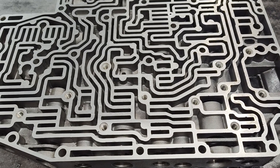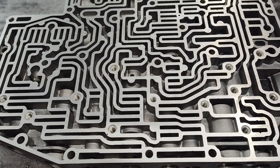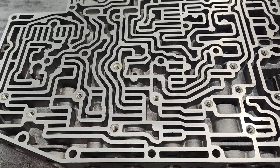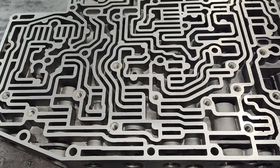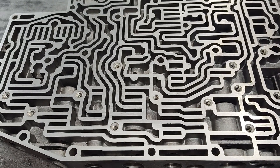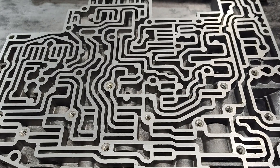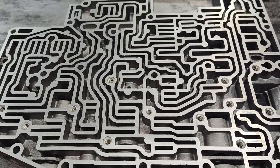This unit is typically pretty burnt up because pressure is so low in them. What happens is when they shift into third gear, the pressure drops — it's what they call the cutback circuit. So your pressure goes from, let's say on a high throttle run, you leave in first gear and you're making a good 200 pounds of pressure. Well, when it makes a 2-3 shift, that pressure will drop to like 100 pounds. And especially if your TV is not properly set, you may only make 75 pounds or something. That's why you see these high gear and overdrive band burnt up a lot — it's because of that pressure cutback.